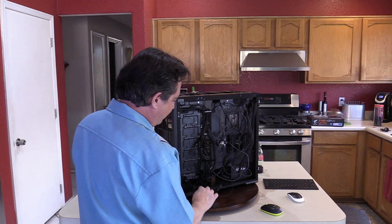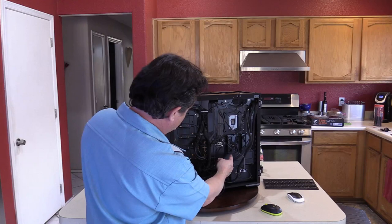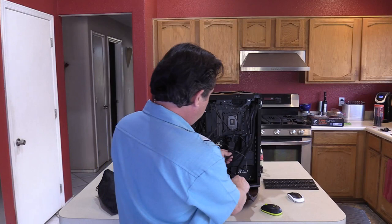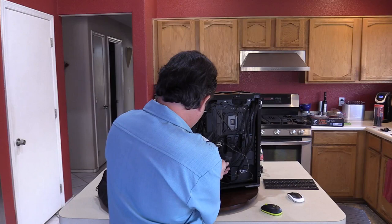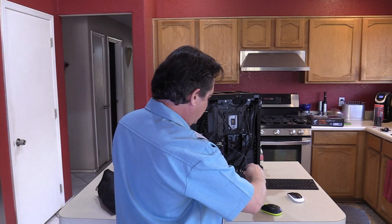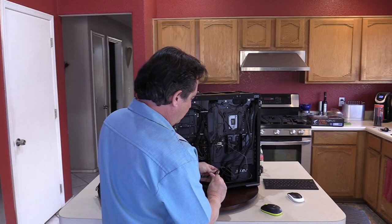That's the mechanical drive, and then will we reach? No, we won't reach. We can't reach the SATA drive if we plug in the SATA over there. What a bummer. What if we did it a different way? What if I had plugged the SATA here? Could I reach here? See what I'm thinking of my cable management right now? So if I plug this cable in here, and we save this other end, since these are so far apart, we want to use the ends for the drives, and then just anyone in the middle is all we need. They're all the same.